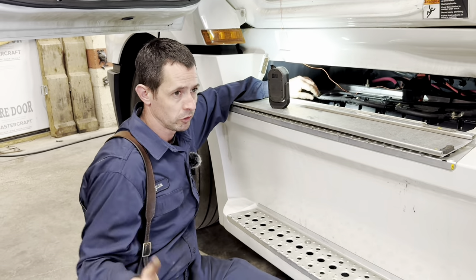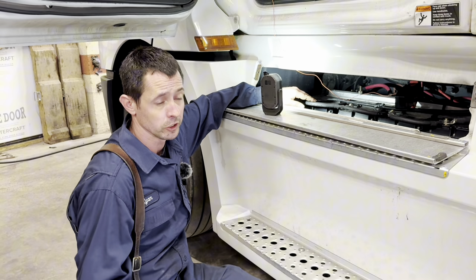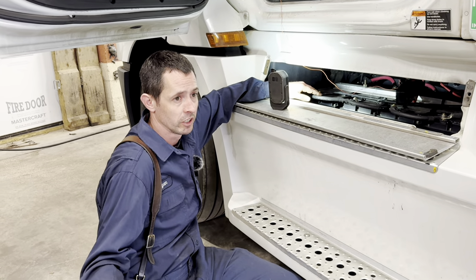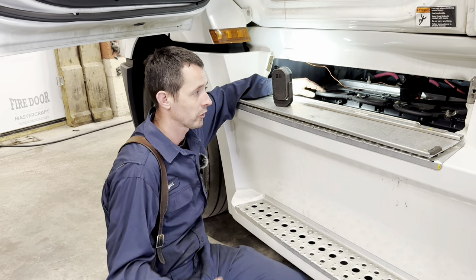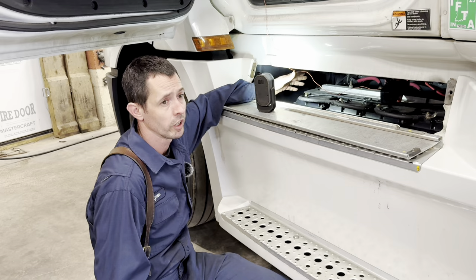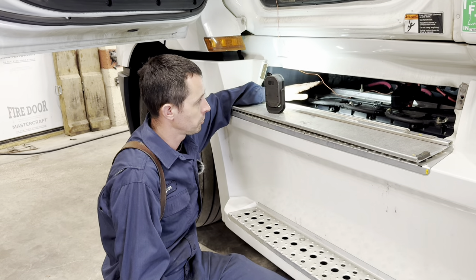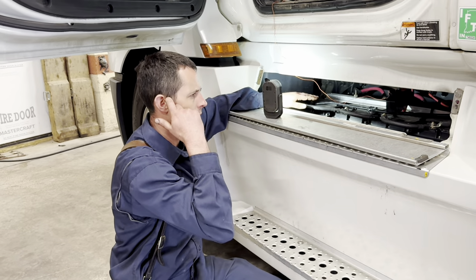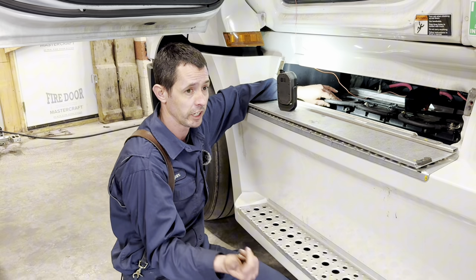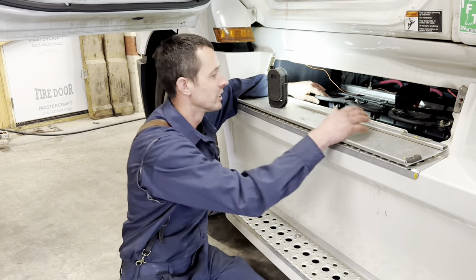Since we're down here looking at the batteries, I want to talk about them for a second. These are the new lithium starting batteries we have. I know we get a lot of comments like 'you can buy these lithium batteries on Amazon for $279.' When it comes to batteries, we've found out in a lot of different applications — even something as simple as a Dyson vacuum cleaner — that cheap batteries don't last. These particular batteries are warranted for five years. Life expectancy is up to 10 years, and OEM use in Asia averages about eight years out of them. You really get what you pay for. These are 100 amp-hour and I believe around 2,200 CCAs. Essentially one of these batteries replaces three regular lead-acid batteries — your 925s roughly. A lot more power packed into this.